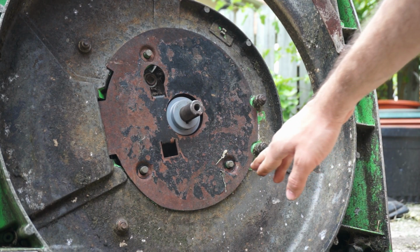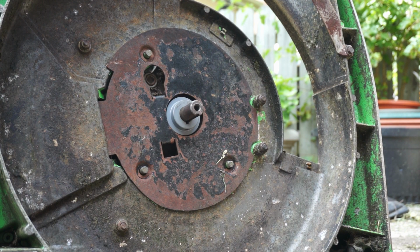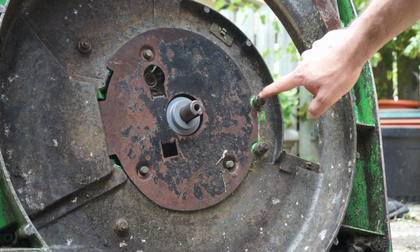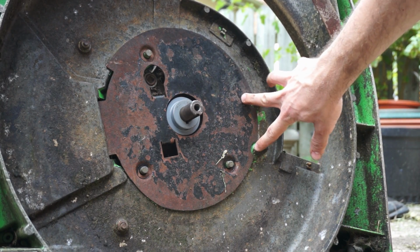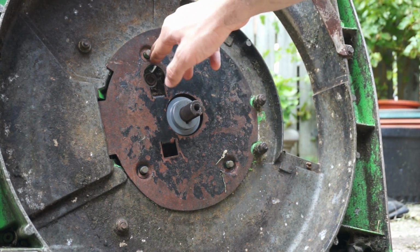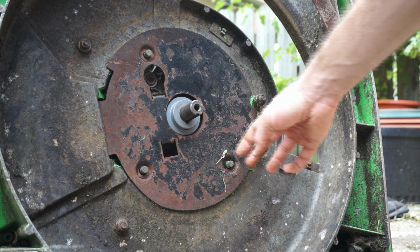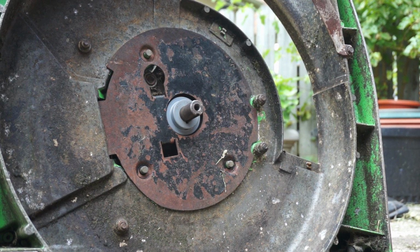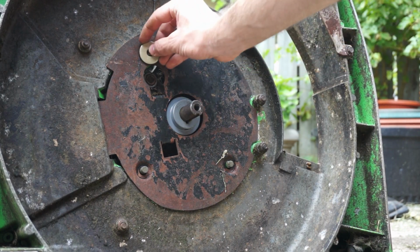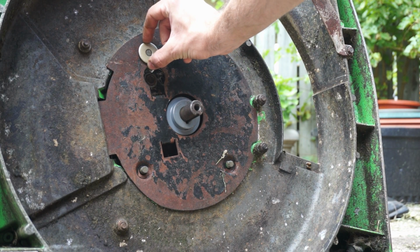I was thinking I could drill holes in here and then put a couple washers on there with a screw. That might work. Or I could also maybe make a bracket that came off of this bolt on either side, kind of a bent piece of metal. But I think I'm going to try to drill out two of these holes, like drill little holes in the center of two of these, and put screws and washers in there. It's just aluminum, so it should drill pretty easily. And see if I can just layer up a couple of washers on there. You know, something kind of like this. Get a washer, put that like that, and then put a nut, a bolt in there to hold that on.